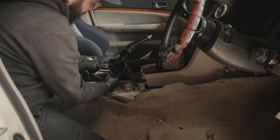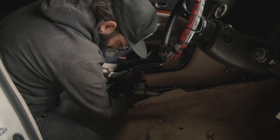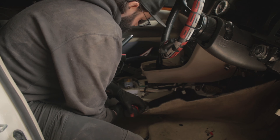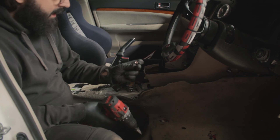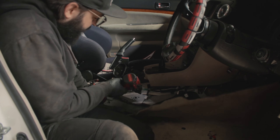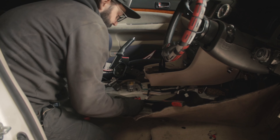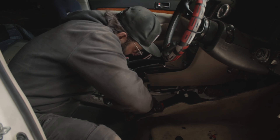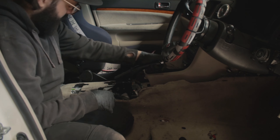I've got the handbrake all attached with its cable — it's not tight yet. I'm putting the handbrake into position, marking where to drill. Using a stepper drill bit and putting in some rivnuts so we can bolt it through. I love using the rivnut gun — once you've got rivnuts, you never go back. The result retains the adjustment as well, unlike the other conversion I did.